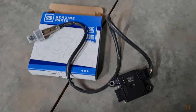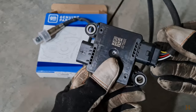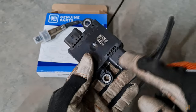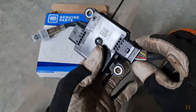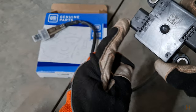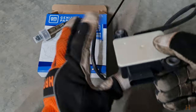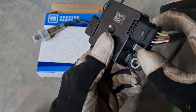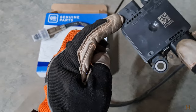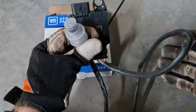Let's quickly look at the new sensor out of the box. When you're tracing it back, you'll see it's going to be mounted on top. The plug you're actually removing is not the one closest to the sensor — it's going to be the one on the opposite side of this box, which goes toward the front, because this whole box comes off with it. Don't try disconnecting it from the sensor side — that is not going to work.